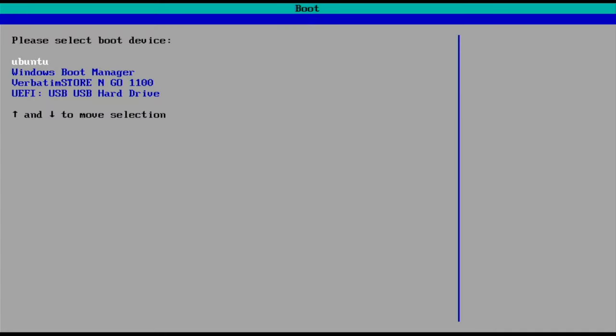Okay, so you have your hardware built, you've got the NICs installed, you've got the Ethernet cable coming from your ISP device to one port of the NIC, and you've got another Ethernet cable going from the other port to a network switch. So what we're going to do now is we're going to boot OpenWrt for the first time.